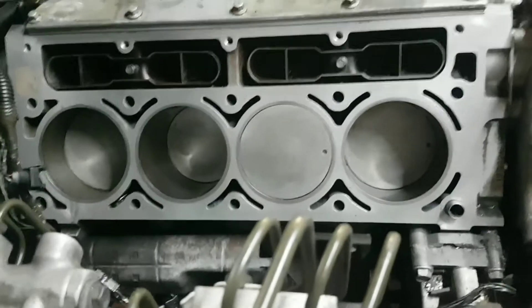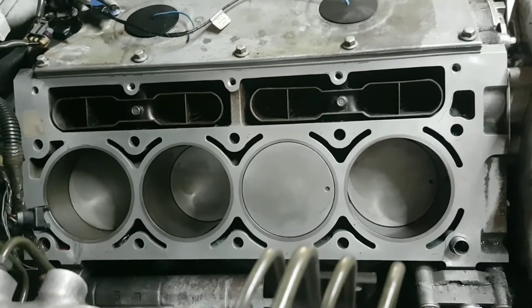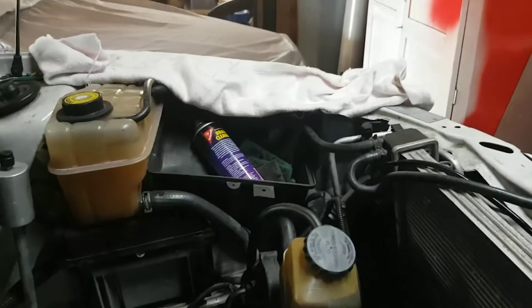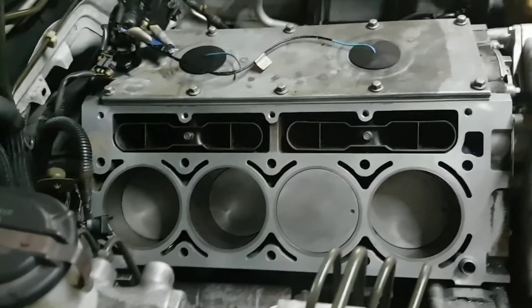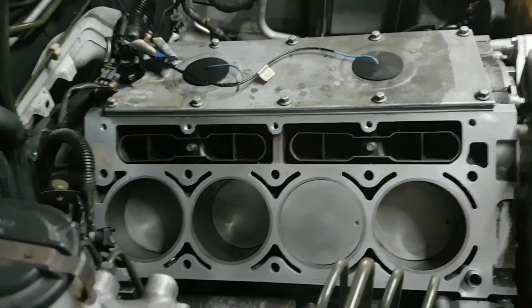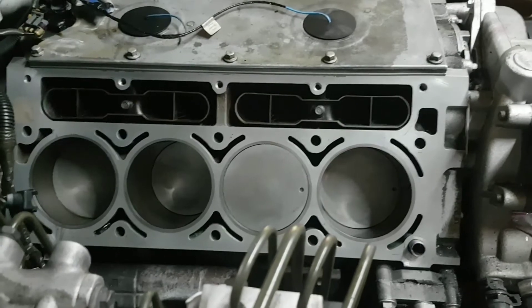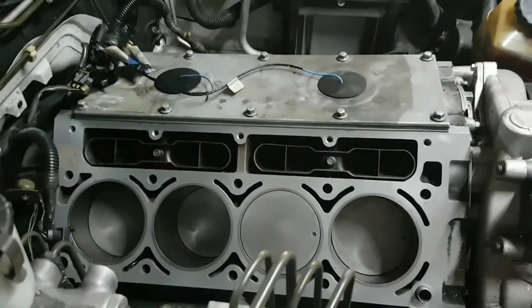I watched another bloke on YouTube — he reckons you should polish the top of your pistons; it sort of discourages carbon build-up. These things weren't really bad though — they were pretty good. It took about an hour with scourers. I started with brake cleaner, but if you ever do this, I found it a lot easier just doing it dry. A lot of people on YouTube say use brake cleaner, but if it's not that bad — these had a fair bit of gasket residue on them — it works a lot better when it's dry. Next video I'll probably be the bottom end hanging out of the car when I get it going.